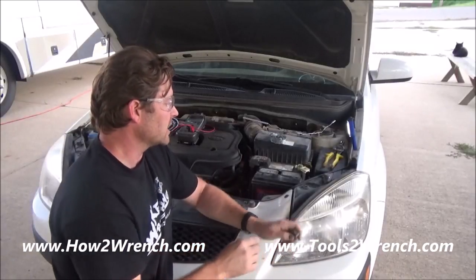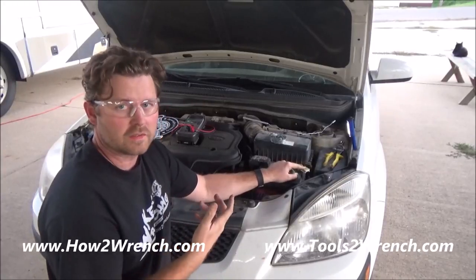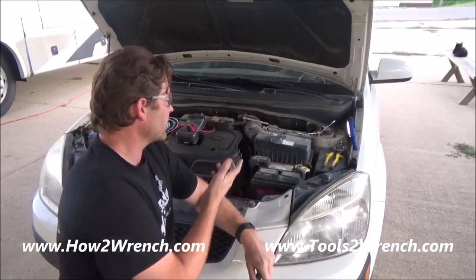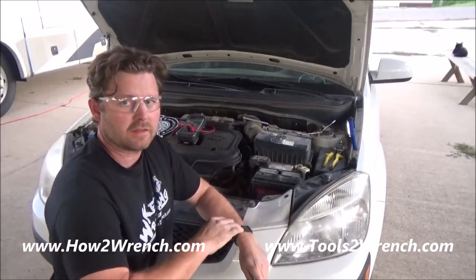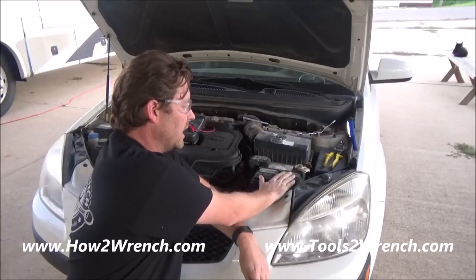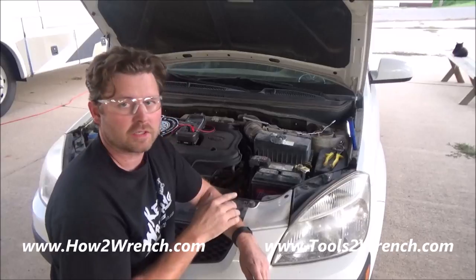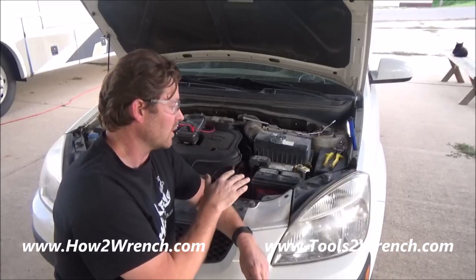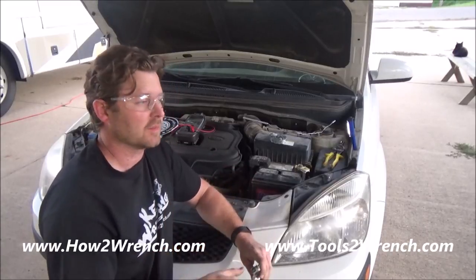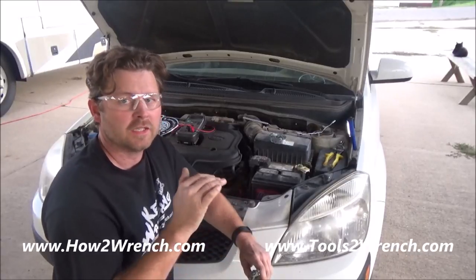There's how to install this quick disconnect so that you can just use a vehicle when you want to use it and not come out to a dead battery. I do want to say that if you're going to walk away from it for say six months, you should be charging your battery — have it on a maintainer if you really want to get the best life out of it, especially here in the Midwest where we get into freezing temperatures. It's really important to keep your batteries fully charged up.